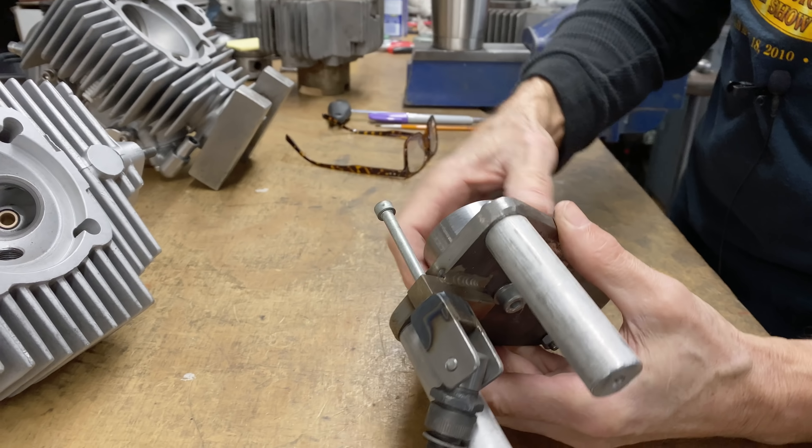You can see here they've had some issues. See all those little marks they made? There's a gasket - this is off the ashtray head version. The gasket goes there and seals it. Someone has made a gasket here because on the stock one it's got a rounded edge, but this one has a sharp edge. They've had a problem with it moving around so they put all these punch marks. There's a relationship between this surface and this surface - when the liner goes in it doesn't use a head gasket, it's just metal on aluminum, probably cast iron. You have to have the right space so that it grips that seal.